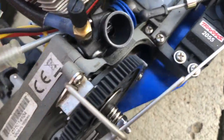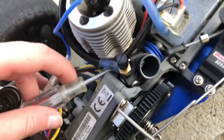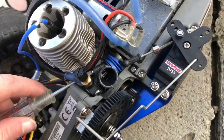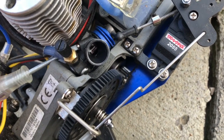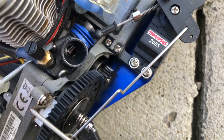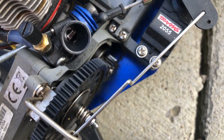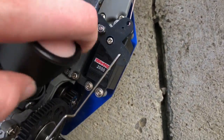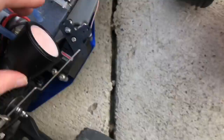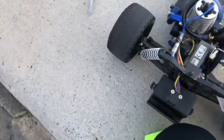Okay. So I turn this screw. Clockwise or counterclockwise? If I want to make it idle, probably want to idle a little higher. So it was clockwise open, I think. So I'll do a quarter turn to start off. It's probably a little much though. We'll find out. I'll keep the body off so we can turn it.